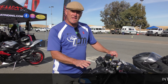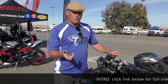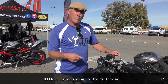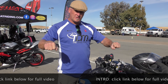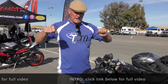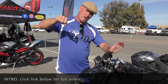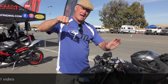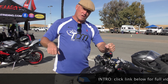So the setting here is only good for somewhere around that mileage. When you have a test day, it's to bring a very analytical self to ride the bike and ask: how am I riding my motorcycle now? Which means as you go through long sweeping corners, can you initiate the turn with your left hand, set the corner up, and then the bars stay perfectly still and it doesn't push on you? If it pushes, then rebound is too fast because it's going down and coming up in the corner.